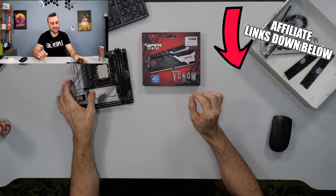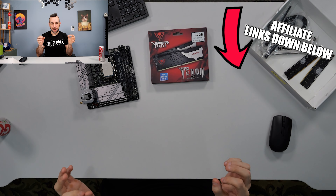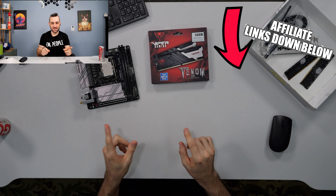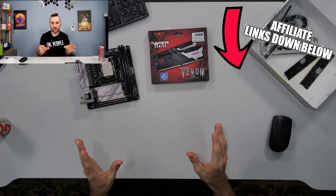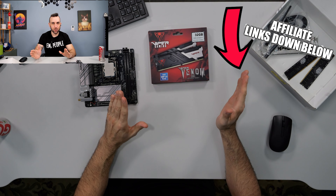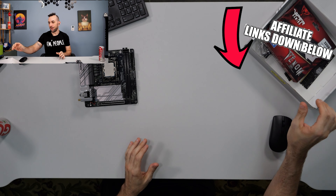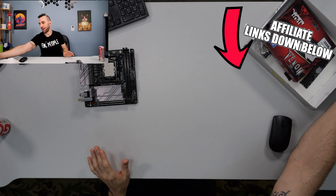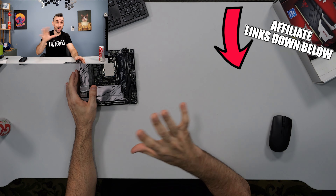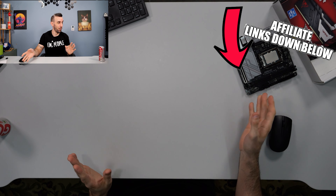This build is specific to using the H1 case. You're basically saving a whole bunch of money on all these parts because the H1 case has a 140mm fan that blows air down over everything — that's the only reason why this whole thing works. If you assemble this in another case, it might error or throttle. I have no guarantees. This is strictly an H1 build only.